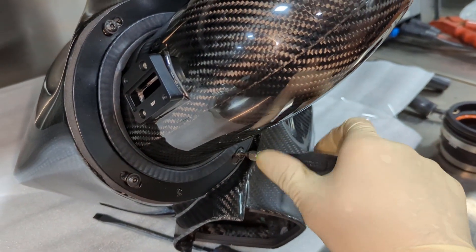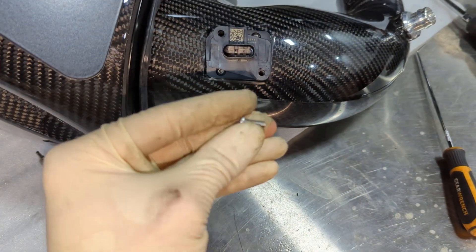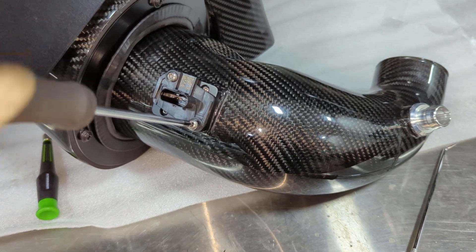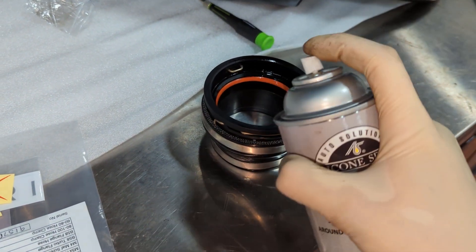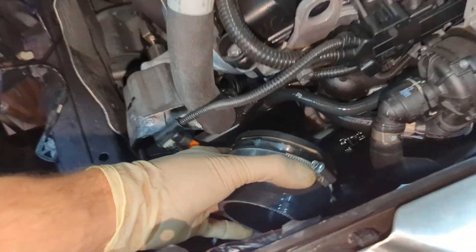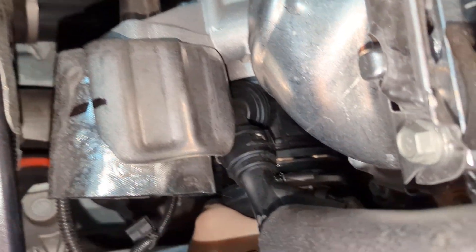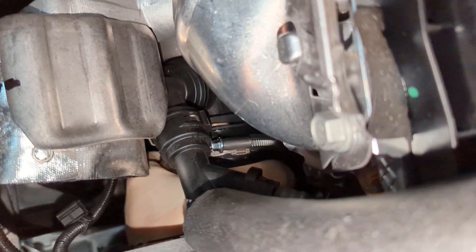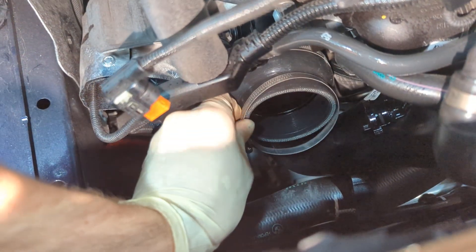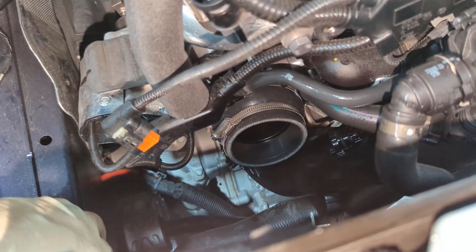Once those are all the way down, install the intake air temperature sensor with those two new machine screws — these are T20s. Then spray a little more silicone spray on the seal so we don't damage it sliding it onto the turbo. Remove that other clamp so you don't drop it, then slide the adapter onto the turbo. You will hear a click when it is all the way into place, when that ring clips over the matching flange. It shouldn't pull back off but should be able to rotate. Put the clamp back in place — rotate it upwards so you can reach it with a long flat screwdriver or a socket on extensions.